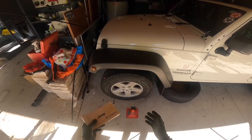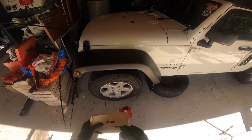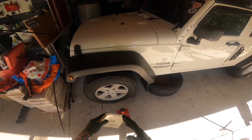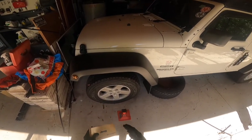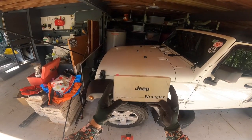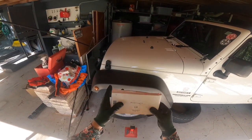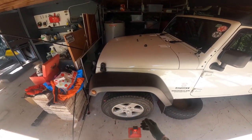That's pretty much it for today, guys. I hope this video helped you jack up your car in a safe and easy way — the safer the better. If you're ever unsure, stop and ask someone for help. Just make sure everything's safe, you're jacking up on the right points, and you've got the safety of your spare wheel or tire underneath. Use blocks of wood and make sure you're on a flat surface. If all that fails, revert to your owner's manual — it's got helpful tips on jacking points. It's normally in the glove box or under your seat, or there's always Google.